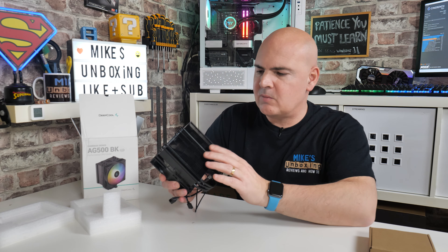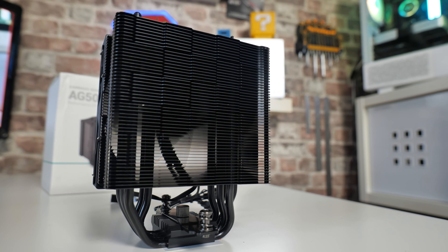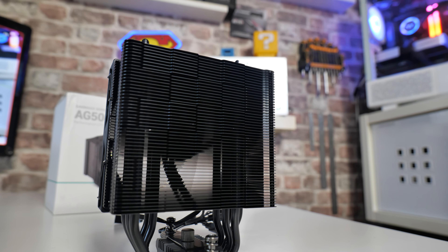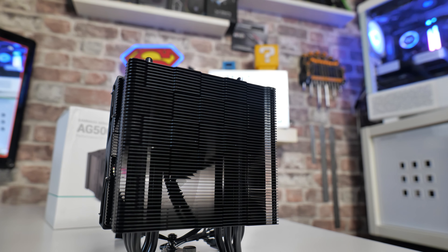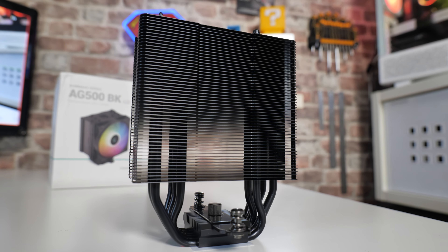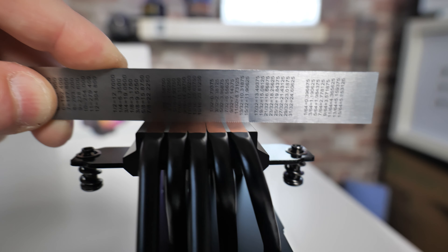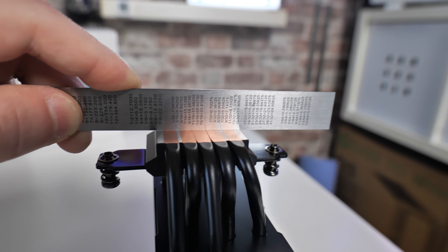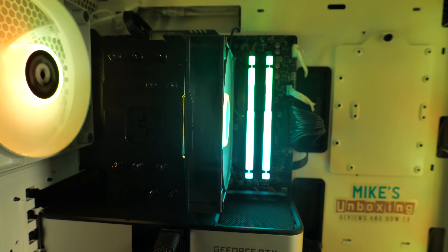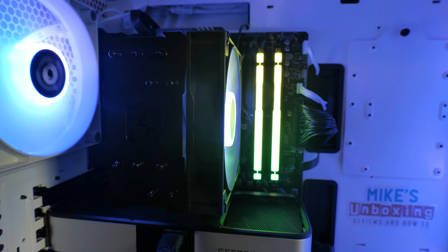On the back of the cooler there's a really nice waffle design, which seems to be a theme in everything from Deepcool — they're doing this on pretty much all of their tower coolers at the moment. That is actually one of the ways you can tell which way to mount it: waffles on the back, flat channel on the front side. The heat pipes also swoop backwards slightly, which means you can have the fan in the normal position with extreme RAM clearance. On every board I've installed this on, you can use all four RAM sticks regardless of height, with pretty much any regular DDR5/DDR4 kit like Dominator Platinums.